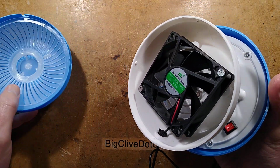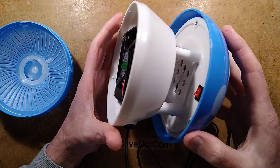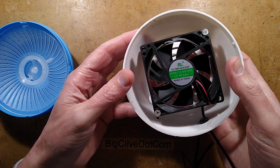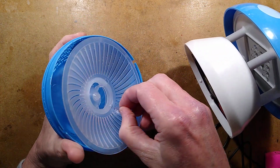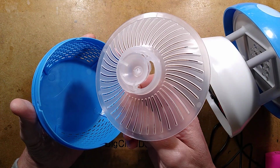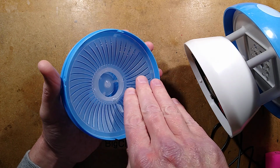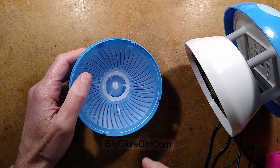So the principle is simple. It's this 5-volt fan. These LEDs, I think they could be ultraviolet-ish, but they look very blue. And the idea is that the insects are attracted in, then they get pulled down by the fan. And then there's this multiple mesh thing with this first layer, and then this other layer. I'm not sure why they've got this particular bit. Oh, I know what it is. It's so that if you turn it off, the flies can't theoretically get out again, because they'll fly up towards light, but they'll actually fall down there. Okay, right, I've worked it out.